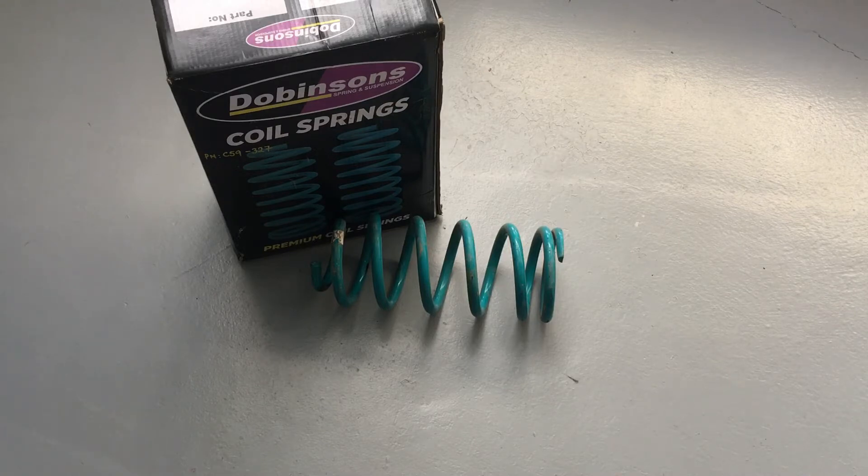There are even heavier ones like 318s, but those five are the most common. If I did 20 lift kits on Prados this week, I'd put my money on those numbers. This is excluding VXs and excluding anything with KDSS. For KDSS part numbers, you can source some of the same numbers — not all. If you're using mono tubes you can even use the 120 coils because you can adjust the spring seat height, but let's keep it simple.